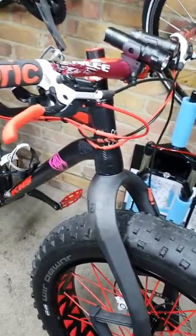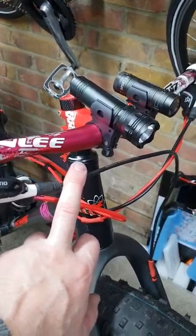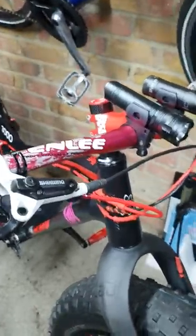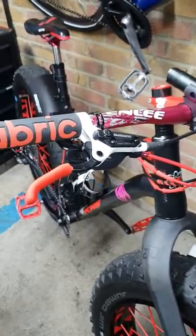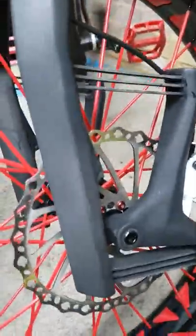The downside for me is I'm running 710mm wide bars. Front hydraulic brakes on most bikes are 750mm — not good enough if you're running bars out wide. I've had to lengthen my front brake hose to 900mm so I could operate it properly.